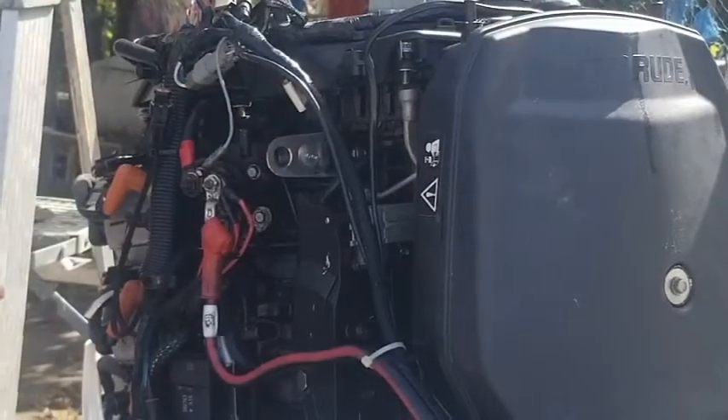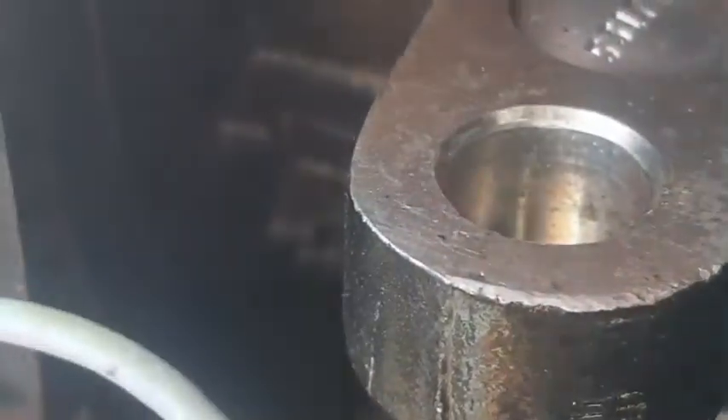Let me give you a close-up of the magnets. Here are your coils, and up against the edge of the flywheel are the magnets — they're epoxied in. Evinrude makes an epoxy; I've ordered it. I'm actually going to find out if there's something better, something with high tensile strength and high temperature resistance. I think Permatex makes something, but this one is actually loose — it's moving around in there.